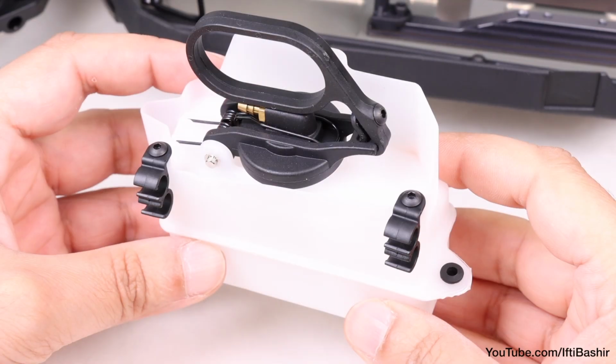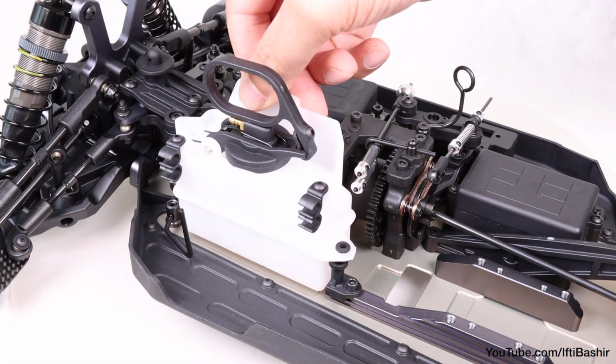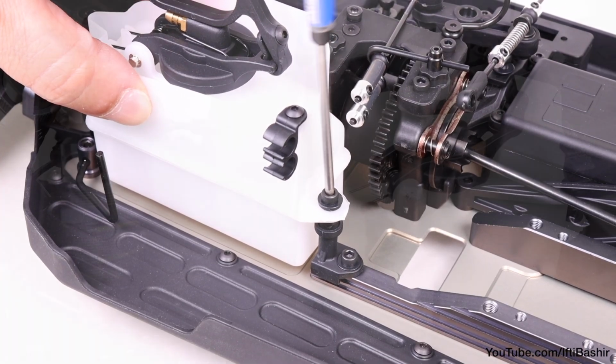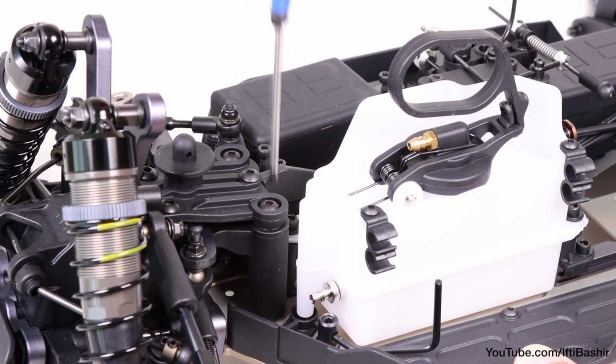alongside. And the fuel tank is then ready to be mounted to the vehicle, easy with two 14mm caphead screws complete with 8mm washers, going directly through the rubber grommets and into the two mounts we just installed. No need to over tighten here, just enough until snug.